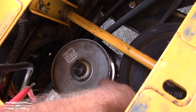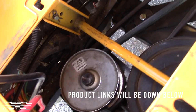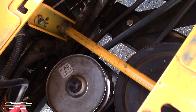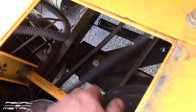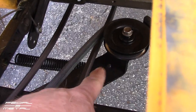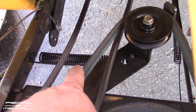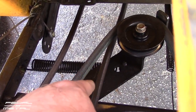I cheaped out like most people — I didn't want to spend the $30 or whatever — I thought the other one had no issues. I tried to repair it and it still didn't give me the second speed I needed, so I replaced that one. But to get to those bottom bolts you pretty much need to pull the whole transmission out. I also put — I think it was at the end of last mowing season — this upper drive belt, which is OEM Cub Cadet, and that goes over to this idler pulley that runs on this bracket with that spring. That spring is very important; mine was worn out at the nine-year mark — I noticed it wasn't pulling tight anymore and wasn't pulling this belt here.